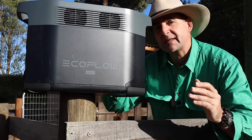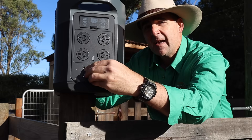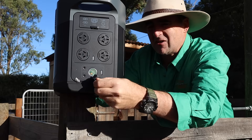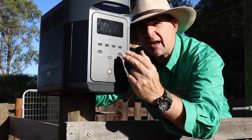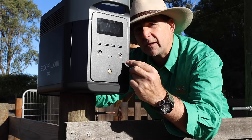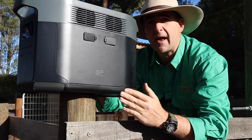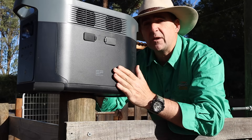Outlet-wise, it meets or exceeds what I've come to expect from these battery packs. There are four household outlets on this side and a standard 12-volt plug behind the little rubbery flap — I don't know why they always do that, but you can plug your fridge in there. Around here there are two fast-charge USB-A ports, two regular-charge USB-A ports, and two 100-watt USB-C ports. Around the back there are two expansion ports so you can plug in the extra two kilowatt-hour batteries, bringing this up to a total of six kilowatt hours of full storage.